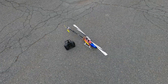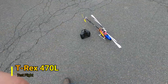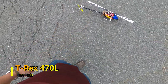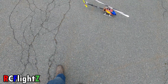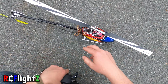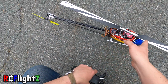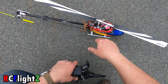I am here with this T-Rex 470, and we're going to do a little operational check flight. I've already hovered it a bunch of times. We added the 74mm blades to it, had a little issue with screws on the motor, got that straightened out, and the whole helicopter was built without Loctite, so we got everything taken apart and Loctited.